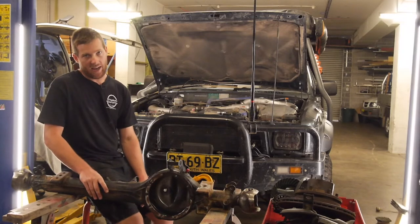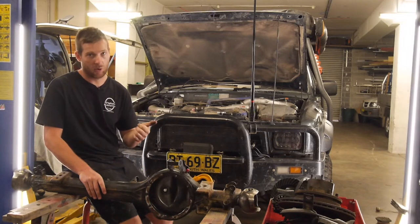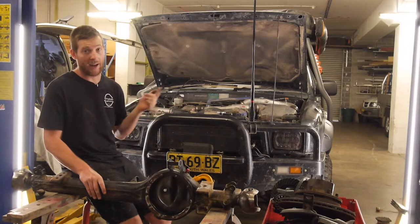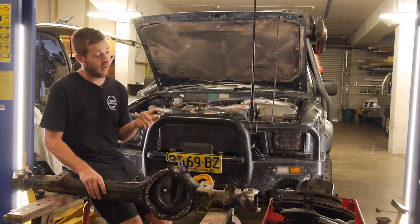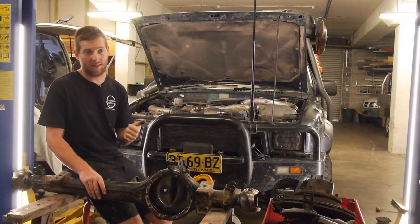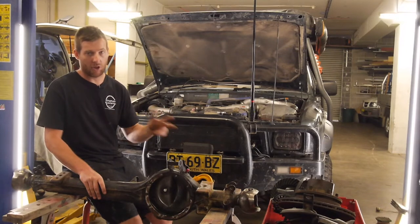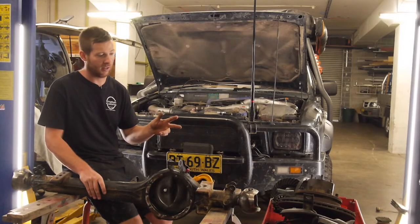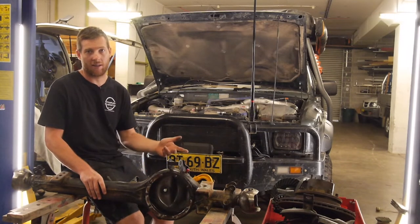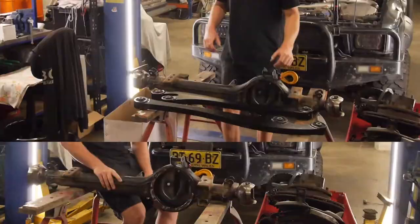The other reason I didn't go the 80 axle, apart from already having this one ready to go, is the greater cost — you're looking at about a thousand bucks, and then you've got to buy gears because 80s don't come with 4.55. They're also wider, which is great, but then you've got to do something in the rear end — either run spacers, put an N70 rear axle in, or an 80 rear axle — none of which I particularly want to do. I would love a really staunch wide wheel track, but I'm gonna see how this goes.